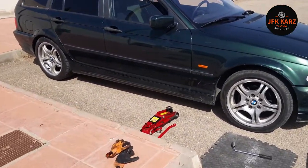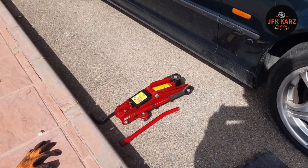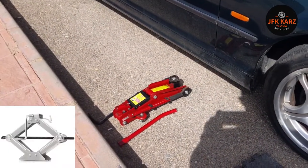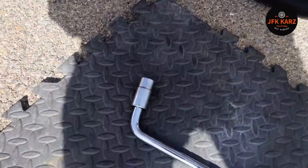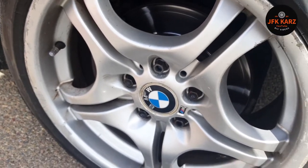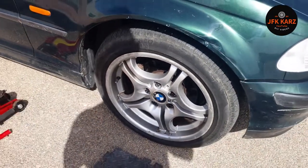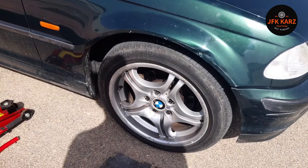Have yourself a suitable jack — something like that, that's an aftermarket one. Some cars do come with their own standard jack, and obviously a wheel wrench. That's a 17mm on this one, so we've got five bolts to remove. What I'm going to do is slacken the bolts before I jack it, just to untweak it a little bit.